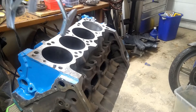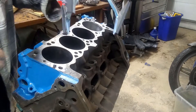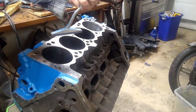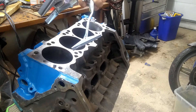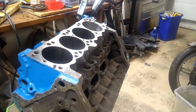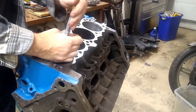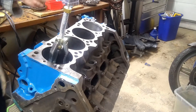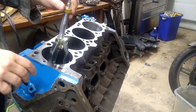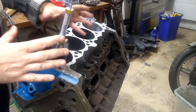To start with, make sure that the stones are clean and we don't have any large particles on them. I'm going to lubricate the faces of these. Then we just squeeze it together, slide it in, and let go. This adjuster can provide tension for how hard it pushes out — it doesn't need to be super hard.